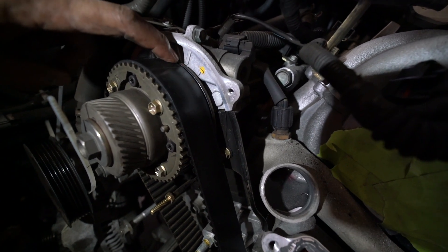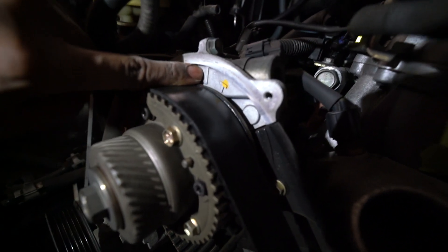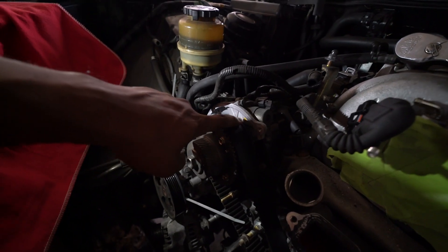There's a groove on the cam here — you can see it — so these are all lined up, meaning it's timed correctly, with the crank at zero. But what you actually want is 50 degrees after top dead center, which is what I read. There's a pin on the housing cover — when you remove the belt, you turn it to 50 degrees so it lines up with that T-mark. The reason is when you release the tensioner, there's no tension on the valve springs or cam gears. The valve springs put pressure on the cam and can snap it out of place. At 50 degrees after TDC, everything's released — take out the belt, put the new one on, release the tensioner, and it won't snap the cams out of place.